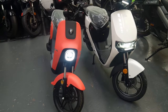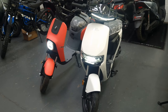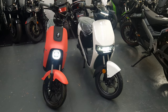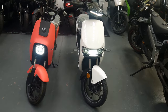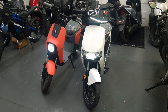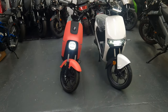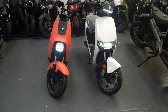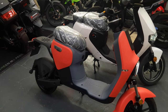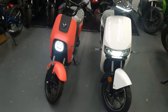To set the right expectation, these are lightweight, which is obviously good, but relatively low power. The Supersoco CU Mini has a maximum power of one kilowatt — your kettle will probably have twice that if not more. It's going to have one and a half horsepower max. So if you put this on the back of your camper van and take it down to Devon or places with hills, don't be surprised if it's found lacking. They are not meant to shoot you up one-in-three or one-in-four hills. We will take the CU Mini out and test it on our test hill, which is one in seven, to see how it gets on.